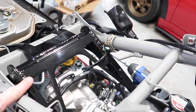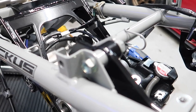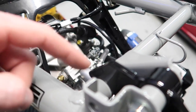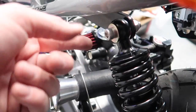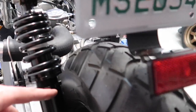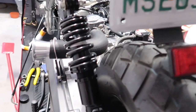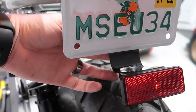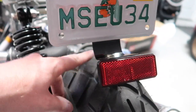So the 9.5 stretch is on and the shock arm is on. It's the one provided — use your factory bolt, goes right through into the nut. I used a little bit of Loctite. It has a little hook section that hooks around the bar and comes back. This one we're using the low boy shock — ran the bolt through to the provided nut with the washer, low boy going down. Still has clearance on the stock tire — I can run my finger between the two, so that's perfectly fine. The only issue is going to be the factory reflector. I'm going to take the plate off and make a cut behind it so you don't see it — this reflector will be gone, I don't like how close it sits to the tire. I talked to the owner and he's cool with it.